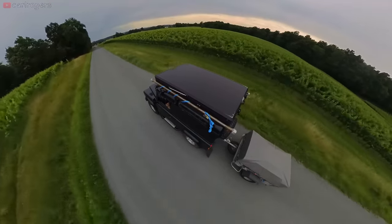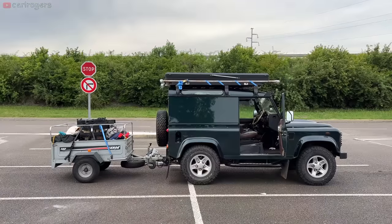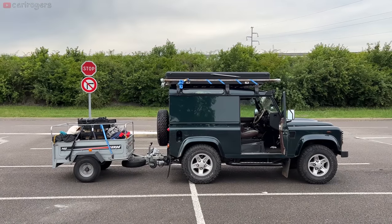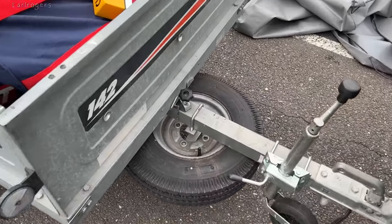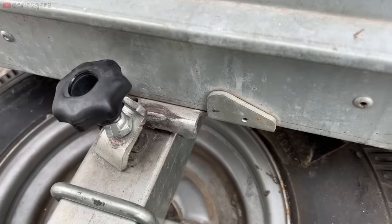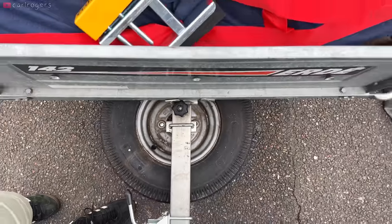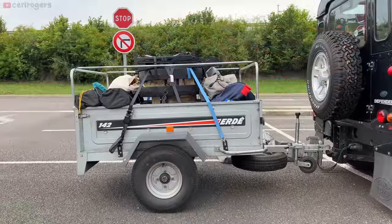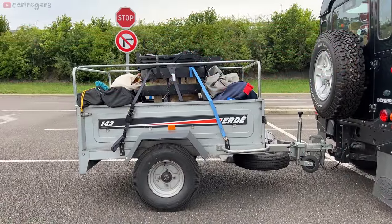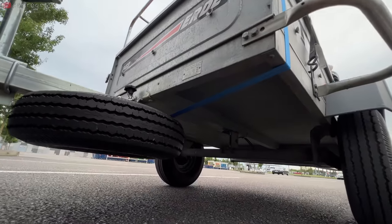About 600 miles in, and with at least 150 still to go, I noticed a problem. This is actually a tipper trailer, and the only thing that holds the front down is a bolt and nut which clamps onto this minuscule tab. Too many bumps had twisted the trailer out of alignment. A few millimeters more and it would have dumped everything into the path of anyone behind us, and ripped the trailer in two. A very scary thought. A quick fix with a ratchet strap, and I drove the remaining hours watching out for potholes and speed bumps.